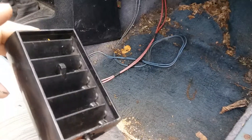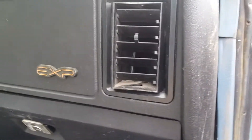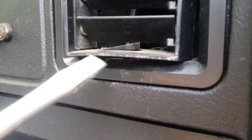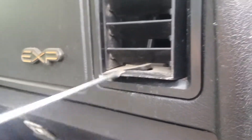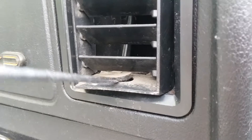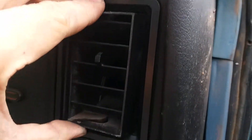There's not much to these guys — they're pretty easy to remove. I'm not going to click it in all the way, but when you have them in there, I found that the best way to remove them is to slide a small flathead screwdriver underneath the entire assembly. Then take a really fine flathead screwdriver and sneak in underneath this tab that's popping up. You have to do that on the bottom.